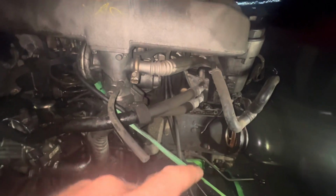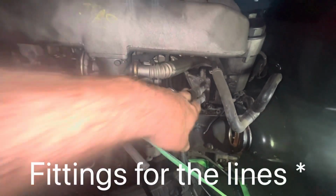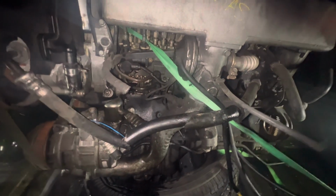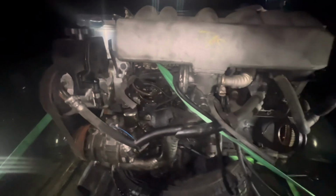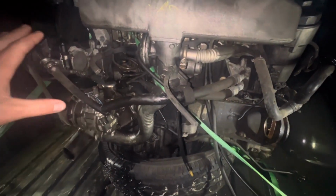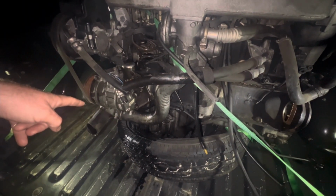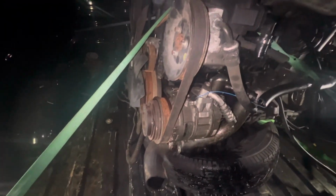If we keep this oil cooler, we're going to get the lines that he makes. And I believe there is a fuel heater somewhere on here that will be bypassed with the Benz Force plate, and then be capping this off and getting rid of a bunch of things that we don't need. I'm going to try to keep the AC compressor and make that function, because that would be nice. I hate driving around in a vehicle, even when it's fun to drive, and not having AC.